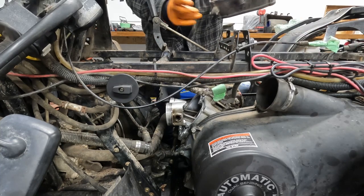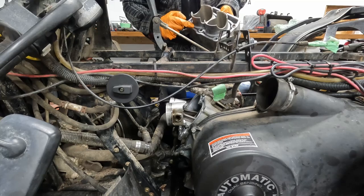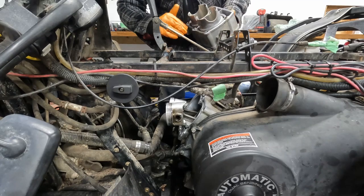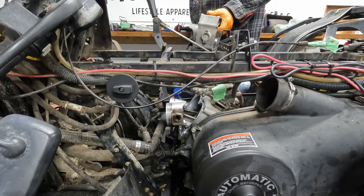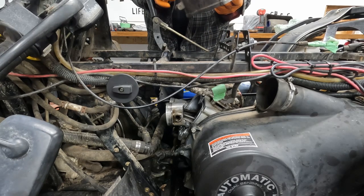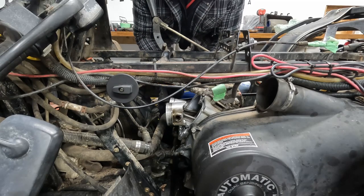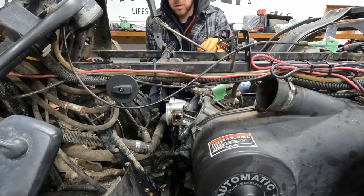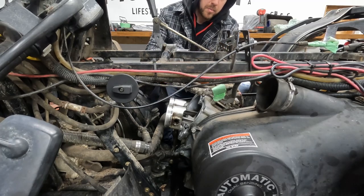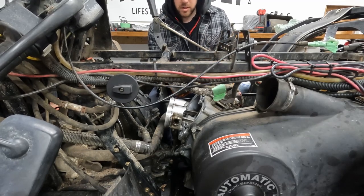Now that our surfaces are all clean and we've gotten rid of all the old gasket material, we're going to put a new base gasket on. The service manual says to put a little bit of grease on the surface here so the base gasket sticks - not too much, just a tiny little bit. Grab your base gasket and slide it over. A lot of people like to take off the pistons, put them in, and then put this whole assembly back and put your wrist pins back in. I'm going to try to wiggle it in without taking the pistons off.